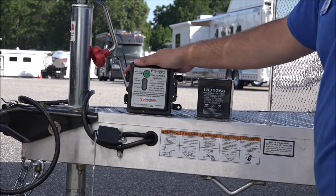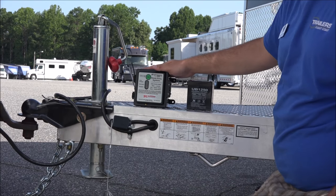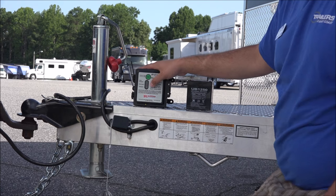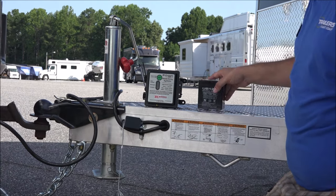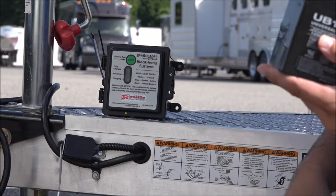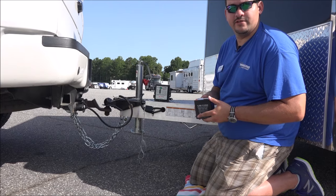Usually the batteries are housed in a box. You'll see some simple ones that are just a plain plastic box, or you'll see some fancier ones like this one here from the Engager that actually has a tester built into it, so you can easily tell if your battery is charged up. The batteries themselves are small, they're available through our parts department, cost a little over $20, and typically need to be replaced every three to five years.